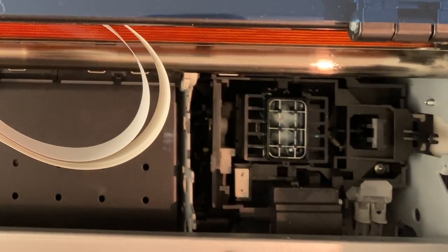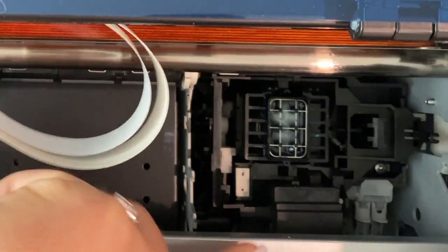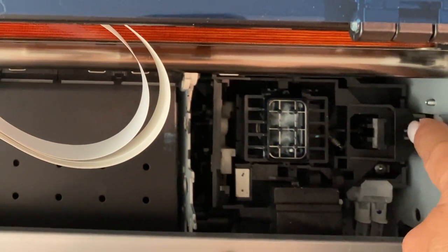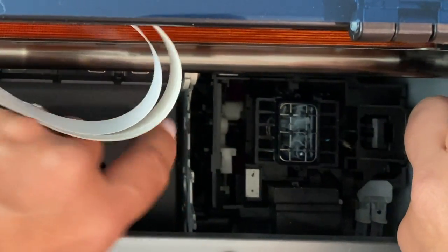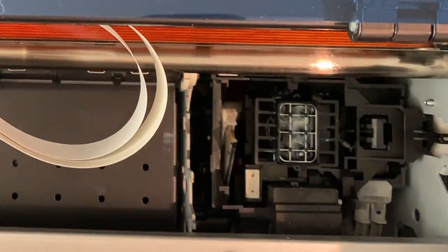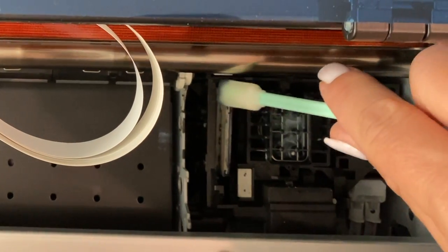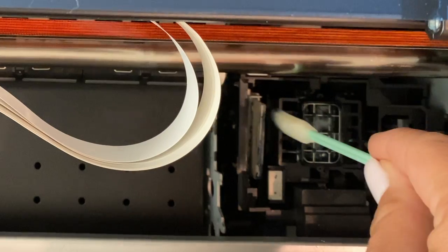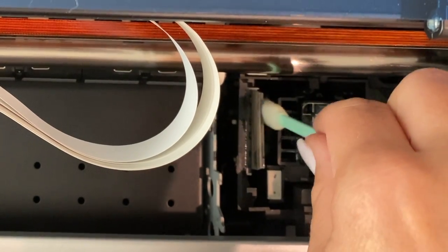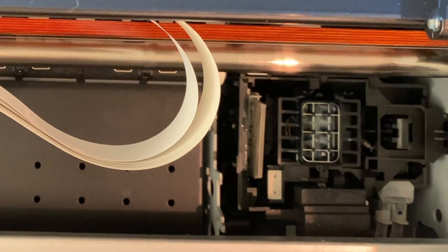The second thing that we want to do is get that wiper. The wiper is attached to this little white thing — you can see this small gray area in front of it. We need to flip it up. In order to do that, you're going to come over here and compress this, and you see how it moves this whole area? If you can do that with one hand and then use your other hand to push the wiper back — this right here is the wiper, this whole gray part, and we want to clean that. You can use your swab with the cleaning solution to clean that. You can see I got a lot of stuff off there. What you don't want is for ink to get caked on there because it won't print correctly.